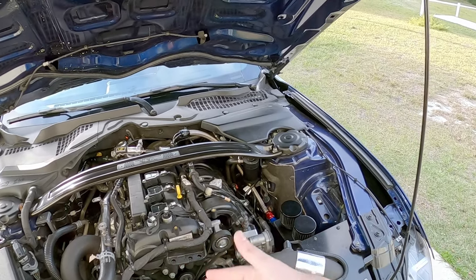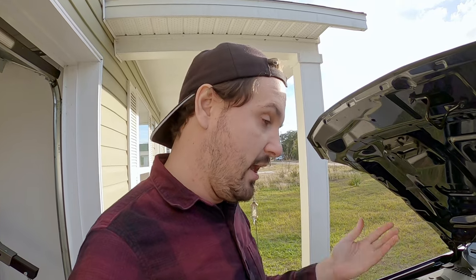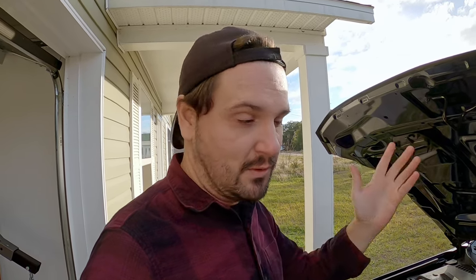I'm not going to get any more power out of it until I do that tuning, which is why I switched gears on my original intentions. I was going to scrap flash tuning altogether and go to a JB4. The problem is the JB4 will run into the same issues — I started realizing that after reading about this stuff for months. The JB4 will run into the same issues as the Boost Max where you're not going to exceed the pre-programmed torque limits of the car. While the JB4 still offers great features like boost by gear that you can't really program into the factory computer, for it to do its job it still has to have all those torque limits raised. You might get momentary spurts of extra power until the car realizes it isn't right and starts closing the throttle plate.